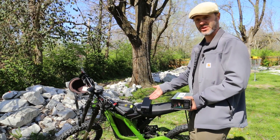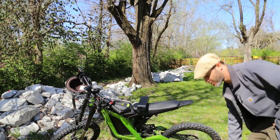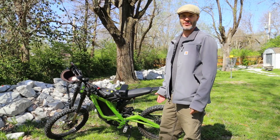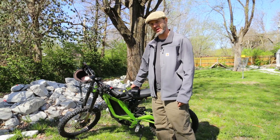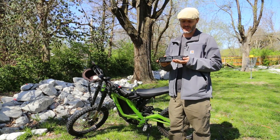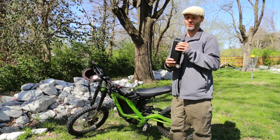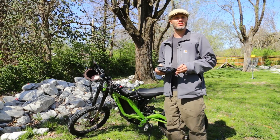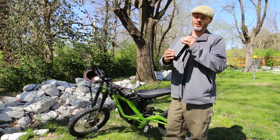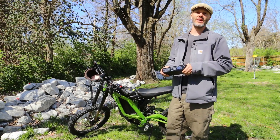I kind of want at least an option that's not so high-speed charging. That's pretty much my reason for wanting an aftermarket charger. The stock charger is a great charger, but it doesn't quite meet my needs. I'd like something that draws a little less current from the wall, and also mounting it on the bike directly — having something that's fully potted on the inside and waterproof — is really going to make that possible. I'm actually going to turn the power down on the stock charger in a future video by finding the potentiometer that adjusts the charge rate. If you have any questions about the charging setup or which model this is, it's basically the HiVolt model from GrinTech. I don't think it has a model number, but go to their website, ebikes.ca, and check it out.